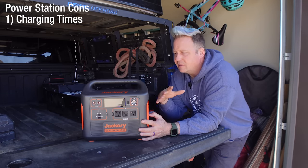Another big pro to this auxiliary battery setup is I'm not just limited to the things I need to plug in for camping. I can power all the accessories of my rig off of this — I can't do that off a power station. All of my lights, my air compressor, my Midland radio — all of that stuff can be powered with this. I'm actually about to pull all of my forward-facing lights, my light bar, my LEDs down front, my rock lights, and disconnect those from my starter battery and rewire them to this. So absolutely nothing is going to be running off my starter battery except my Jeep. None of the auxiliary stuff and accessories will be powered off of it — they're all going to be running off this. I can't do that with a power station, so this gives me a lot more flexibility to run all of my accessories and protect my starter battery.